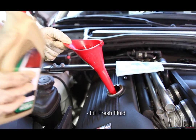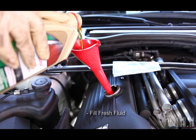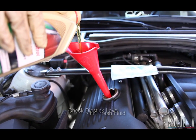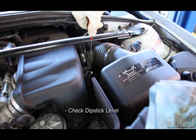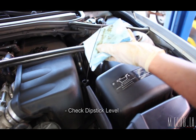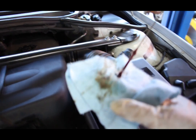Finally, after making sure everything's sealed up, pour in some fresh oil — usually about five and a half quarts — and check the levels. If it's between the marks, crank the car, let it run for 30 seconds, and then recheck the levels and add oil as needed.